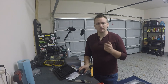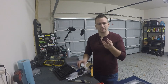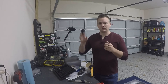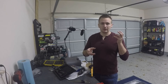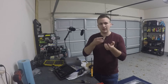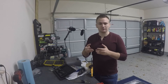One of the screws that came with the kit is just a little bit too long. There's a module just underneath the mounting for the tray. The passenger side has the normal mount for the screws, but the driver side has a smaller mount because there's a module that sits underneath it. So if I don't trim this down a little bit, it could go into the module.